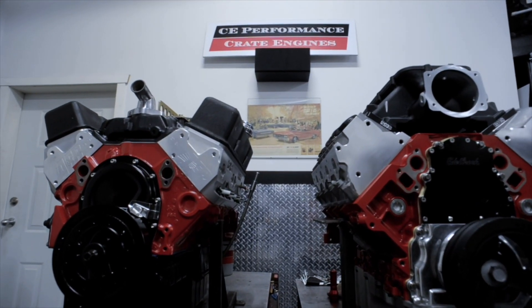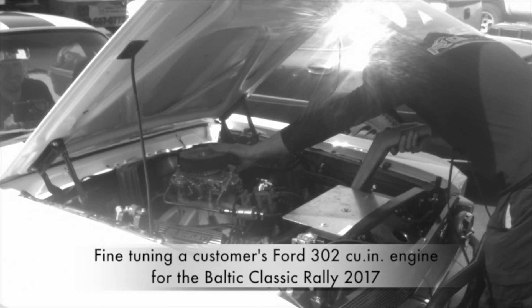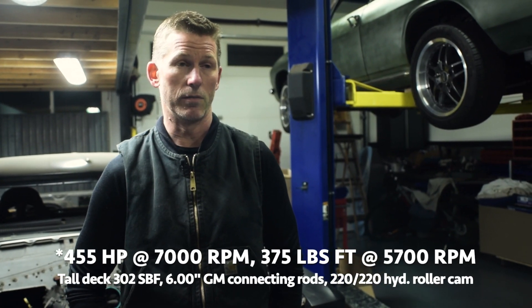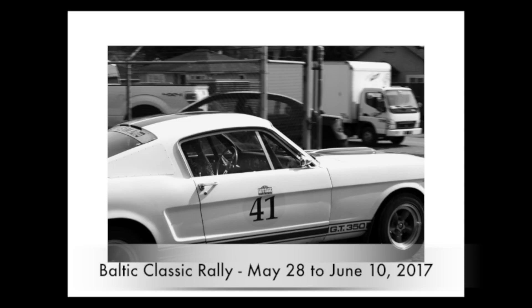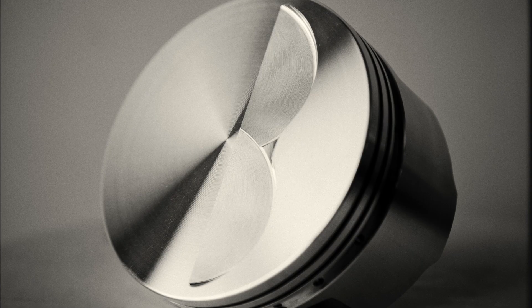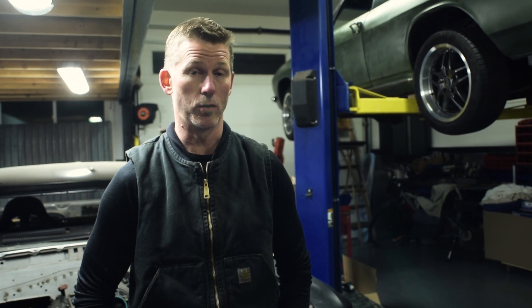So we've been playing with different rod-to-stroke ratios on different engines. We built a small block Ford — took a 302 build and put in a really long connecting rod. It was a tall deck block with a six-inch long connecting rod with a three-inch stroke like a 302 would have. That made over 475 horsepower going into a Mustang that a customer had. We've also done other things with LS engines with long rods. And now what we decided to do is fit a 283 small block Chevy crankshaft into a 400 block, because we wanted the largest piston with basically the shortest stroke in order to get close to a 2-to-1 rod-to-stroke ratio.